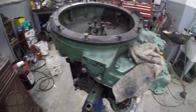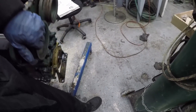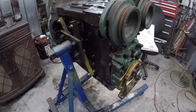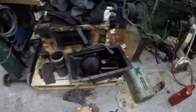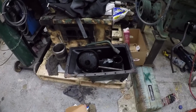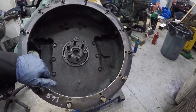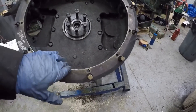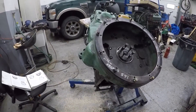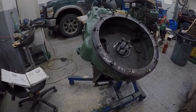While you guys were gone I took the liberty of finding all the parts for this thing. I found the engine mount piece, so that's on. And now I'll put the oil pan on — I've got to go clean that up, it's pretty messy. Oil pick-up and all that stuff, so I'll do that next. So there you have it guys, that's the housing on. It happens to be a number two housing, and this is an adapter ring to make it a number three housing for the compressor to fill. That's the rear housing torqued up, so I'll put the oil pan on next. Thanks a lot for watching and stay tuned for the next video. Take care.